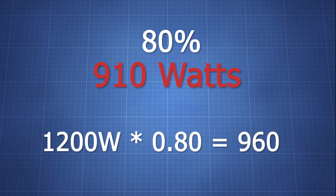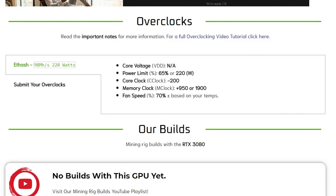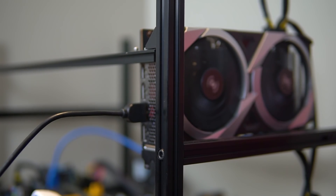There is a safety concern here because these calculations are based on certain overclocks and undervolts that you need to make sure to apply to your GPU. And if those settings ever reset, then you are in the danger zone because you will be pulling a lot more than 850 watts. So it is good practice to get even more wattage, but if you're using a Linux-based mining operating system or have tested and kept a close eye on your overclocks, then this is not much of a problem.